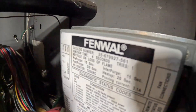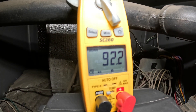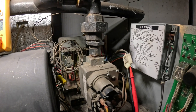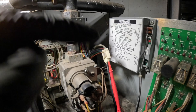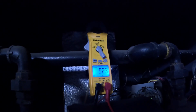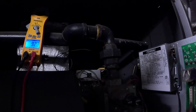Alright, over here it says igniter. And just based on the colors, I believe it's these two — two light grays. Put my meter on resistance, power's currently off — we have 90 ohms. That'll serve as reference. I want to make sure we're getting voltage being sent. If you're not getting the voltage, there's a good chance this control is bad — ignition control. Just to confirm: I got 92.3 ohms, with the wires disconnected, just holding these two wires together. I want to close this up and check for voltage before I make any assumptions.